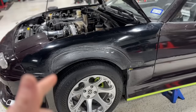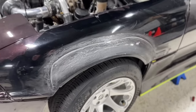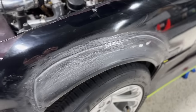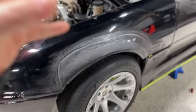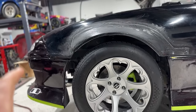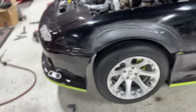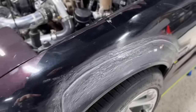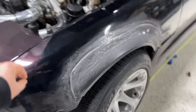One of the reasons I wanted to do this with the fenders instead of just pulling is that Miata fenders are very, very flexible. You'll see a lot of stance cars that have their fronts pulled as far as they can be, and there are inward dents all along there — that's just the fender's metal capacity being fully stretched. With this approach I have them riveted together, and this is a naturally wider arch made to be like that. The wheel arch also matches exactly what the Miata's was. I wanted to prevent those really ugly little inward indentions. I actually did pull the fenders out, but then had to un-pull them — I had to re-dent the fender back.